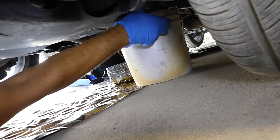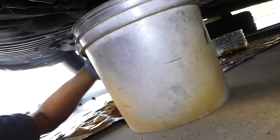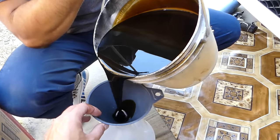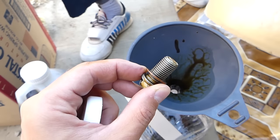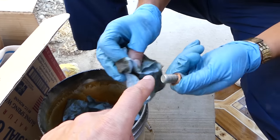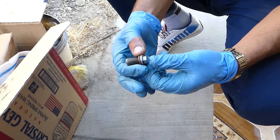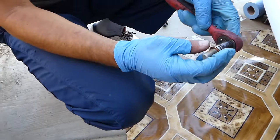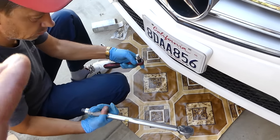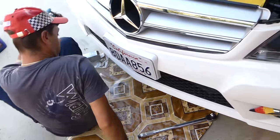Pull the bucket out of the way and leave a small container to find the drain plug we dropped. Always recycle your oil — never throw it in the trash. We found the drain plug; you can see it has the copper washer. Some people replace it on every oil change; we do it every other oil change. The torque spec for the drain plug is 22 foot-pounds.